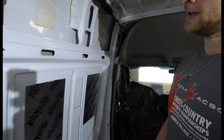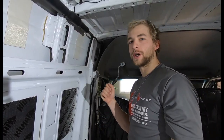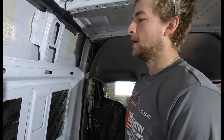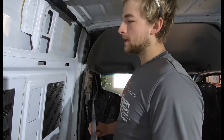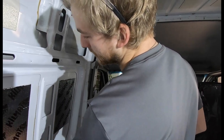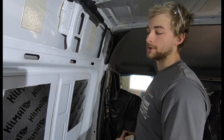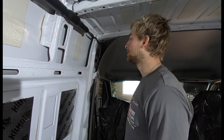Oh, why, hello there. Okay, so now we are putting on the sound deadener. We got 50 mil Kill Mat that we got on Amazon. We will put the link below. Go check it out. We're just gonna do it on all these panels just to reduce the rattling. The guy that had this before sealed all this. Like this is aftermarket stuff, which also really helps with the rattling. So yeah, it shouldn't be too bad.